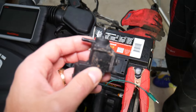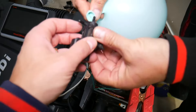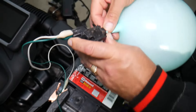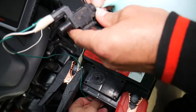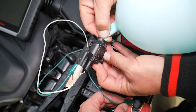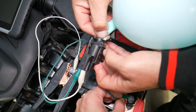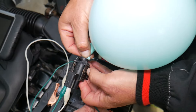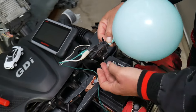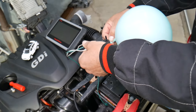To test that mechanically, get a balloon, blow it up, and put it on the inlet side where the vacuum is. When the valve is not activated — no 12-volt supply — it should hold the pressure and not leak anything out at all. When you open it, it should leak out of the other hole. When I open it the balloon deflates; when I close it, it stops. That's a good valve. It keeps pressure, it closes, it opens — everything's normal. Hopefully the video will be helpful. Thank you for watching, see you next time.